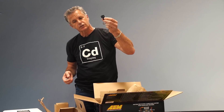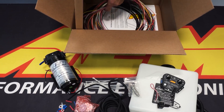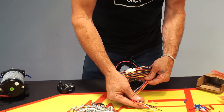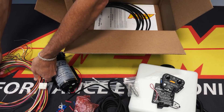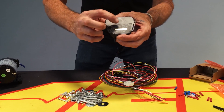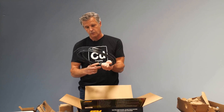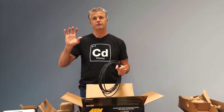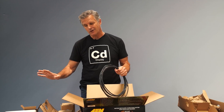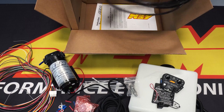The connector for the fluid sensor — our harness is referred to as a flying lead, so you don't have to splice in and add wire length. I believe this is 11 feet in length, everything is color-coded, and the controller itself tells you all the wire colors and where they go. Then there's 20 feet of high-pressure line, good for 300 PSI — it's a nylon type that holds up to methanol and water with no problems. Reminder: never exceed 50-50 with methanol. Methanol burns clear, so this is a safety comment — keep it at 50-50 so it's non-flammable and safe. It's also most efficient that way, giving you the advantages of water injection as well.